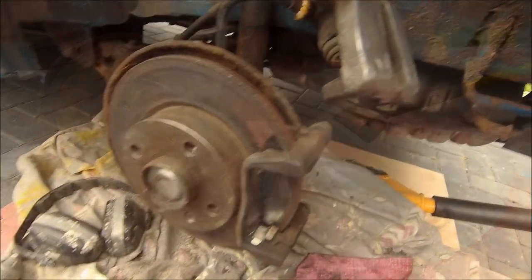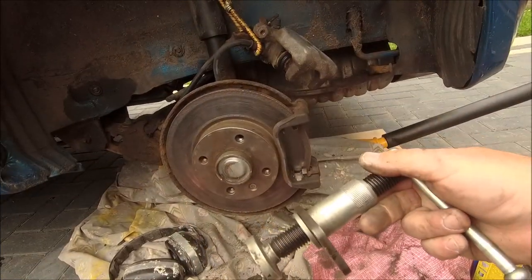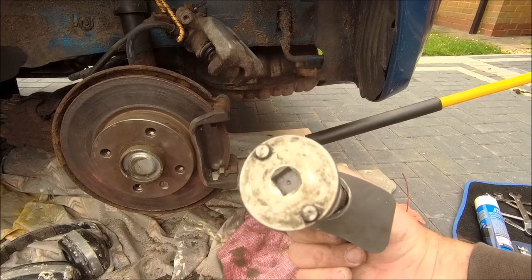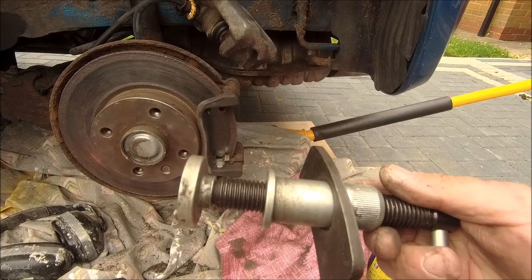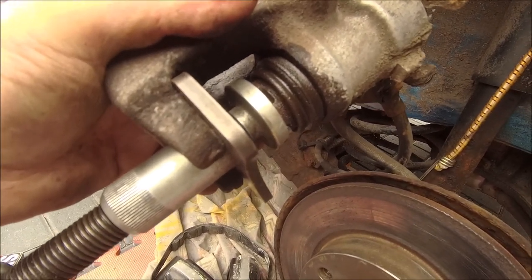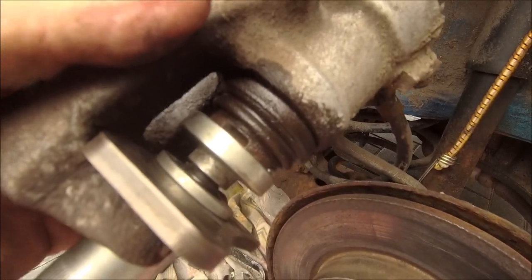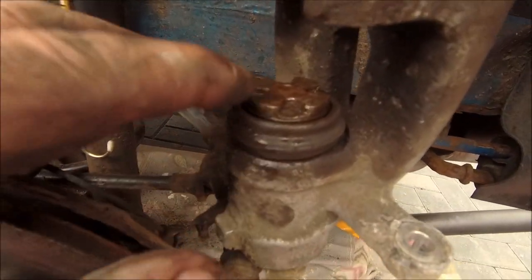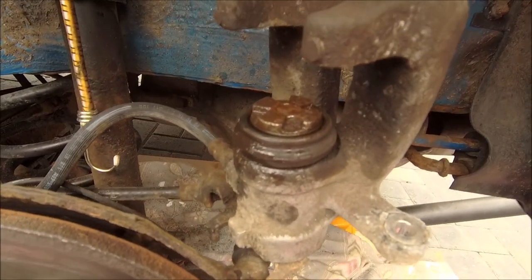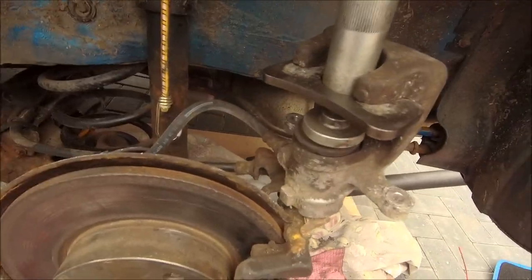Time to get the wire wheel out again. Things have had a bit of a clean-up. The brake caliper pad doesn't look that bad. Now I need to get that piston wound back in — out comes my trusty caliper tool. It's got two pins which should fit into a slot on the piston — it's a little bigger than what I need but we'll make it work. It's actually for an old Audi 80 but it's worked well for everything I've done. Just winding it back in clockwise. You could do this with a pair of grips but you risk damaging the dust seal, and then you'll get debris in there and it'll seize up, so do it properly. A good lashing of WD-40 inside that seal and some persistence usually gets it back.